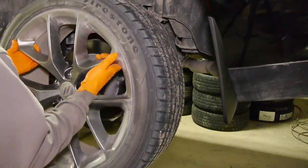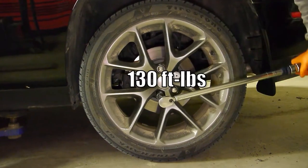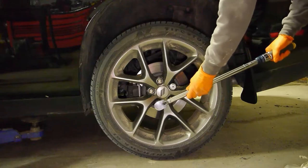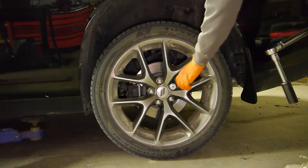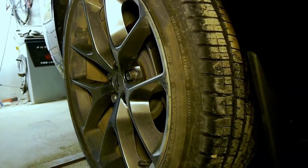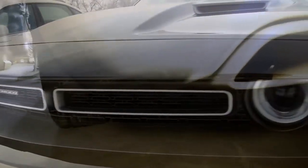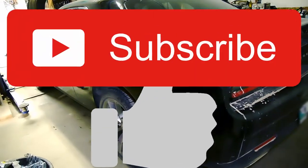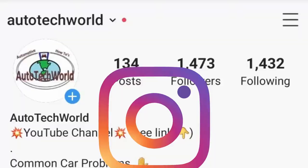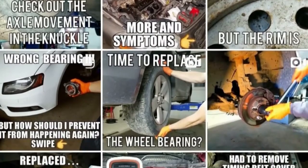Install the tires and don't forget to torque them — the torque spec for these tires is 130 foot-pounds. Don't leave the special anti-theft key on the nut or you'll have a big problem if you lose it. The Challenger doesn't even look bad with mud flaps — check them out in the description, they really aren't a lot of money. Don't forget to like and subscribe, and follow me on Instagram for more car-related content. Thanks for watching.